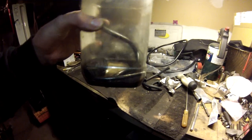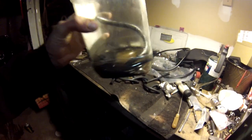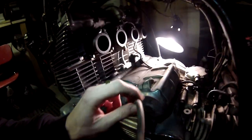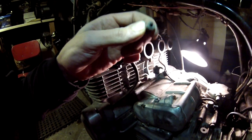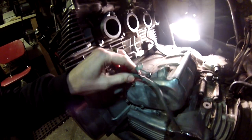I've only got a little bit left in here, and it just barely touches the stuff. But if I got the bottom of it soaked in the juice long enough — just set it and forget it, like Ron Popeil said. I'm working on figuring out the hose arrangement here. I didn't know where the vacuum hose came from in this thing down here. Apparently there's an engine vacuum one that goes to the petcock, and carburetor number two goes to the advance line. This hose right here — this one's not as stiff as the other one. This one's a little bit rubbery. I'm gonna have to see if that moves the advance or not.